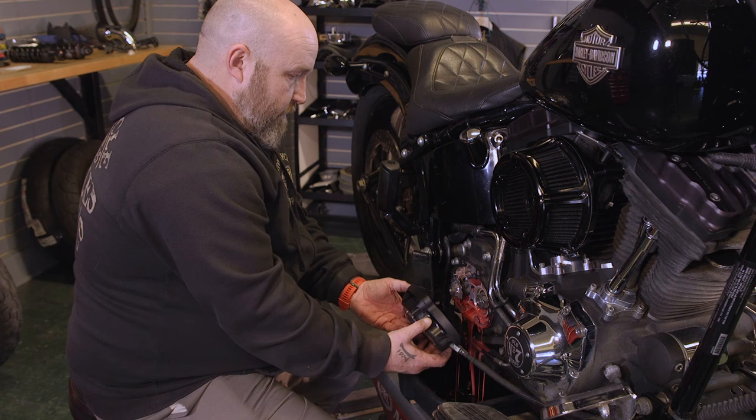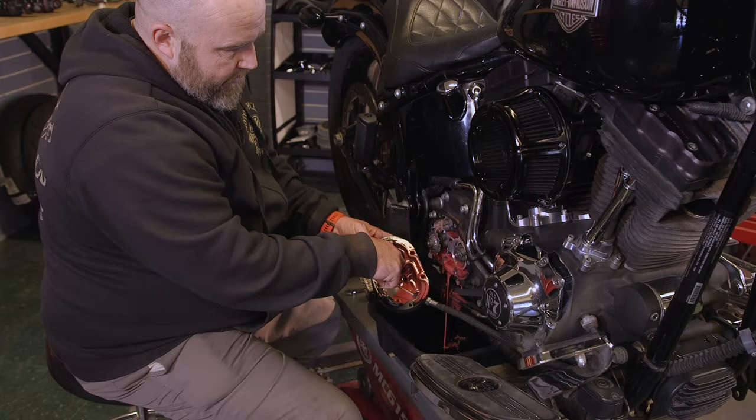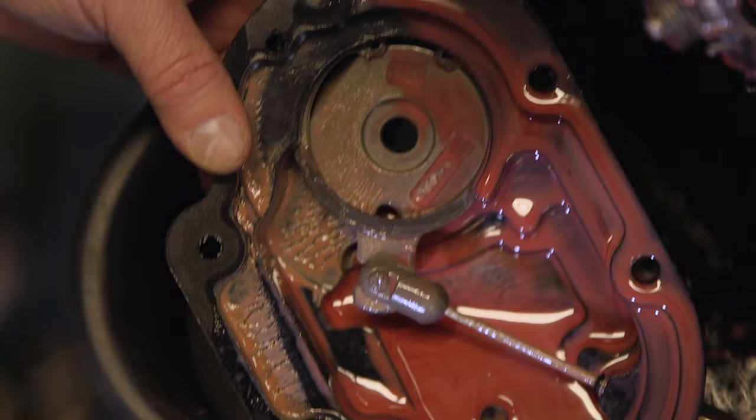Okay, inside here is your little pull mechanism, and we're gonna have to take this big snap ring out right here, and it's pretty taut, so you're really gonna need to probably use snap ring pliers. It's not a great idea to use a screwdriver on this, because this has to slide basically around in a 180 to come off there to get this off of the cable. Then we'll take a 9/16 and unscrew this.